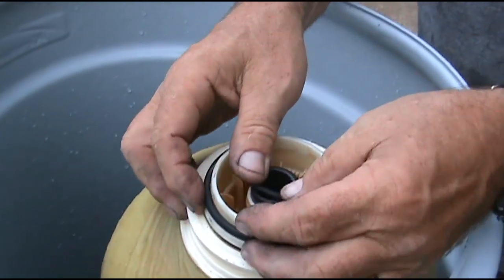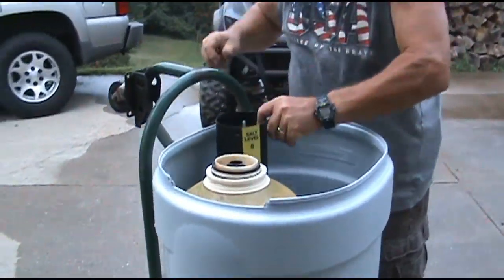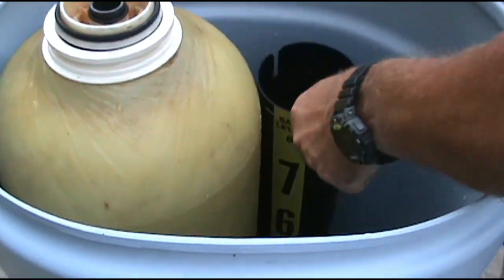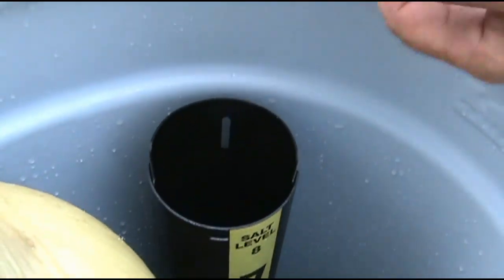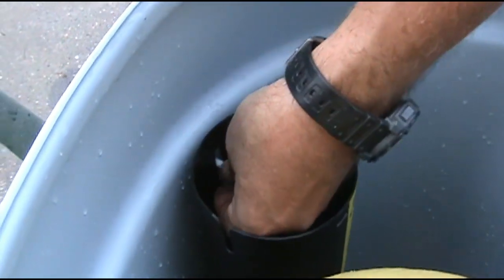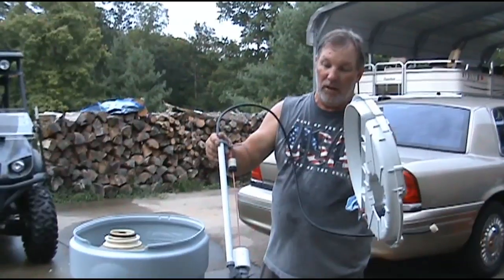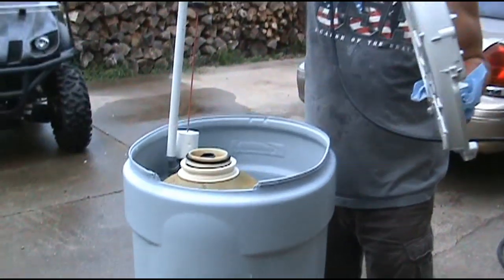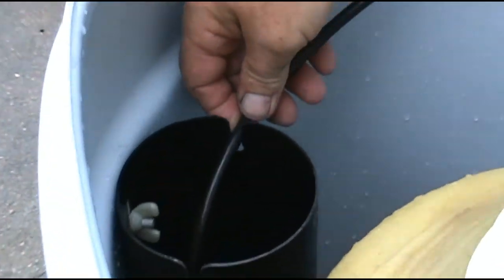I'm going to take this tube and press it down in there. I've got another O-ring here — I'll put it on and seat it down on there. This is the salt level indicator — stick it down in here; there's an indentation where it goes. Make sure it's turned towards you so you can see the numbers. Take this screw and put it in from the outside, then take your wing nut, get it started, and put it on hand tight — you don't have to force it down hard. Now insert the top ring. I've already cleaned this float out — stick it down inside where the salt indicator level is.